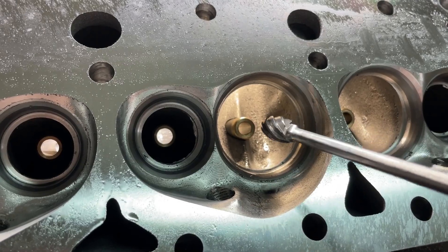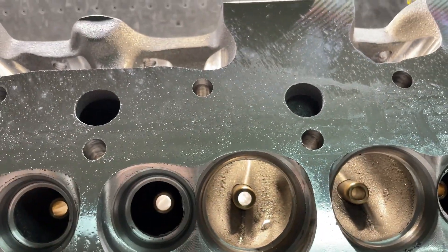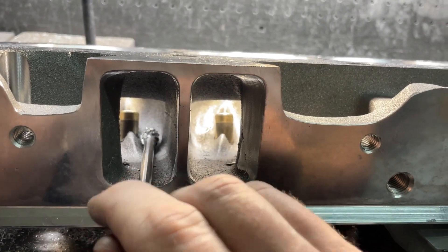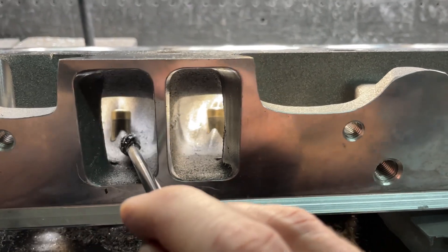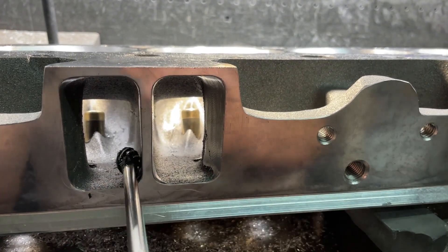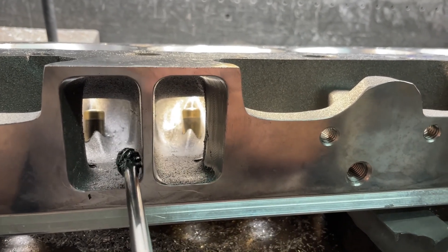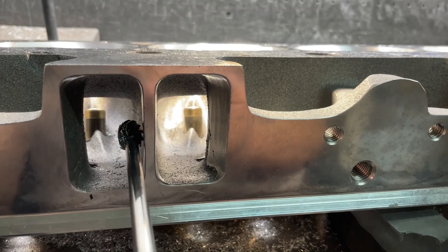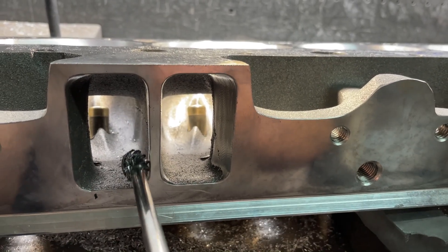Then I do my throat, and that's all in this view. Then I flip it around. Once I get to the other side, I will — and the bowl mark will show where I've been grinding. I'll take this side and grind it all the way and start gasket matching this side and this side. I also measure from the push rod slot across so I can get the right distance and move less material from here so I don't break through.